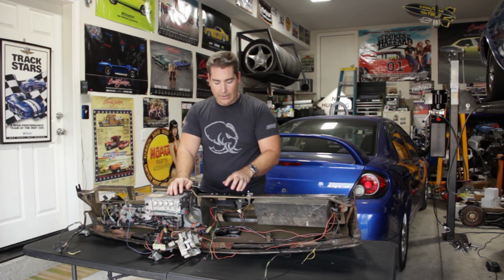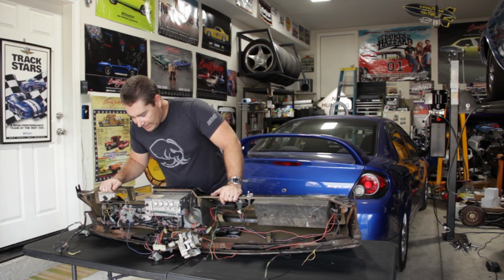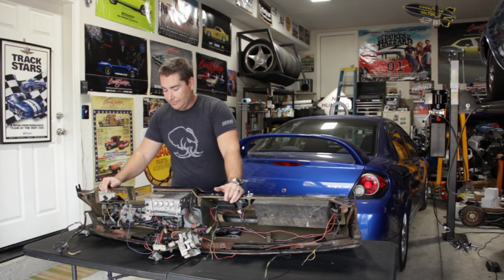And that's most of what you need to do from an electrical standpoint. And then you also have your vent cables. They're bolted usually to the dash, so you need to disconnect those. And I believe that is just about it that you need from an electrical standpoint to pull the dash out. After that, it's just 6 bolts and the dash is out.